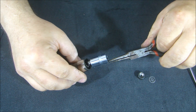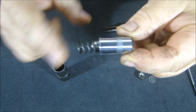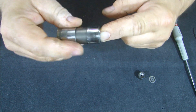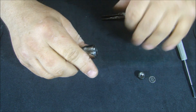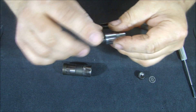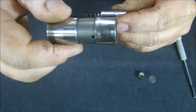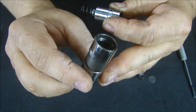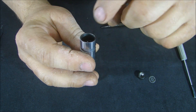Next we have our piston, and on that piston is a spring — this is what pushes up and down. So when you talk about the hydraulic pump, if you push this up and down you can see that the lifter pumps. You have the plunger and the piston, and this also has a hole in it. The oil comes in the lifter through that hole, gets distributed around the inside groove, and gets pumped into the inside of the piston.